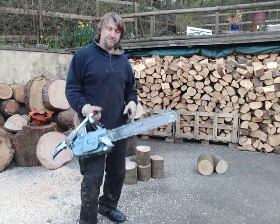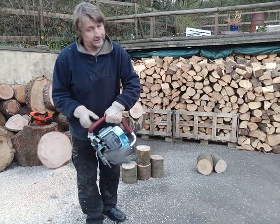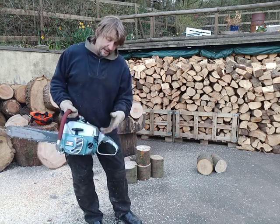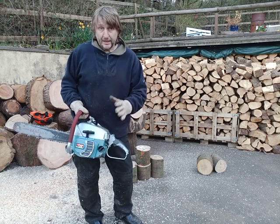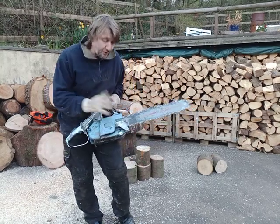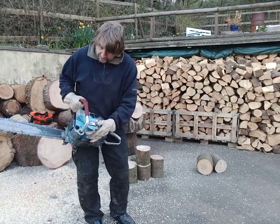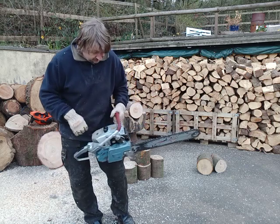And so if you see any of these for sale and they're running intermittently, just bear in mind you might be looking at a coil. The coils do go on them, they're a hard revving engine. So this one's had, like I say, a replacement coil, new plug, a starter rebuild, new fuel pickup, a replacement tank vent, correct carburetor metering diaphragm, and a high quality aftermarket Teflon pump fitted, and both felling spikes are present. On the handles at the top, I've put all 316 stainless steel bolts, and on the side cover, I have put hardened 10.9 knurled head steel bolts around the side covers. And so there she is.